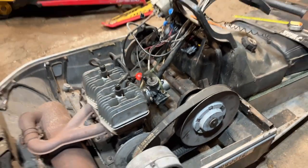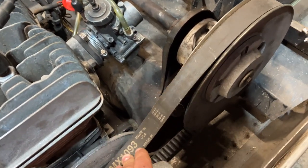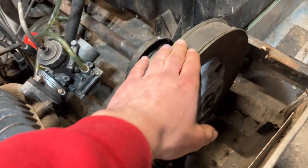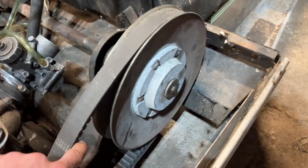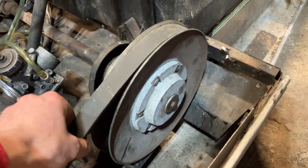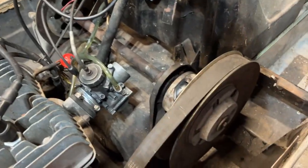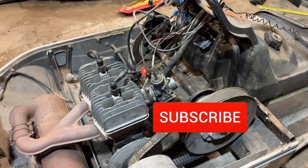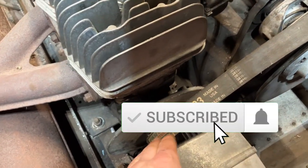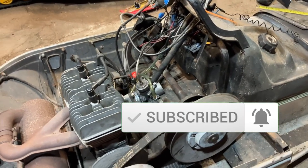This is on an old vintage Jag '79. The belt is a little bit worn on this particular unit, so it is going to be sitting down a little bit in the clutch — that's typical of a belt that wears. Your belt's going to wear on the sides; that's what actually does the grabbing. The cogs are just there for cooling. That's why they went to cogs on both sides — for cooling purposes. It's not really a better or worse belt, it just cools better. This is an old Parts Unlimited belt; they obviously don't make it new anymore — probably have to get an NOS or eBay special.